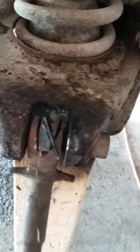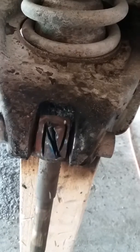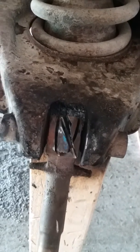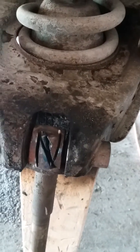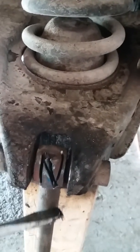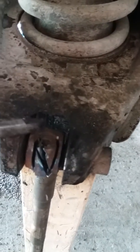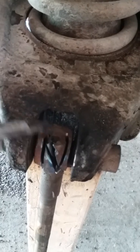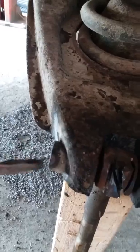When you have it all together, the fulcrum pin and the kingpin stick together like that. And once the kingpin's stuck in there, the best thing I can find to do, instead of cutting your fulcrum pin out, is cut the kingpin out, because at this point the kingpin is worn out and you've got play in it back and forth. The pin that goes in right here, see the hole, just take an oxyacetylene torch, heat that pin up, heat around here, punch the pin out, heat up around this, melt the lead, and scoop the lead out. It'll just fall onto the ground. That's what it looks like when it's all done, not a big deal.